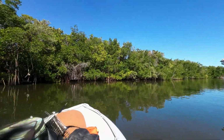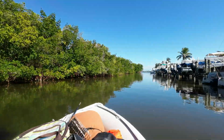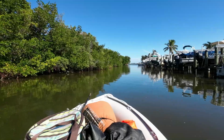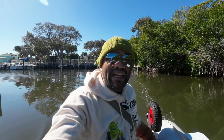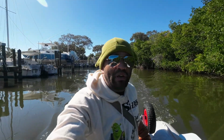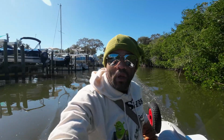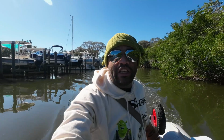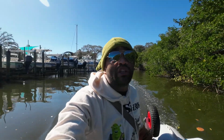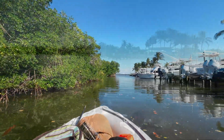All right, so far so good. Moving along just fine as I'm heading towards the water. Just an FYI, I did the break-in period on a bucket at home. 90% of it was done on idle, 10% under load. So I have done some load break-in, but not a lot. Today I'm going to be doing a lot of breaking in on the load. I changed the gas to oil ratio from 25:1 to 35:1 because it's already lubed up. It's ready to go. Let me hit the water and head to the island.